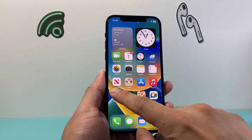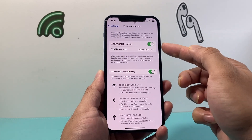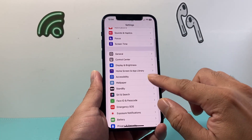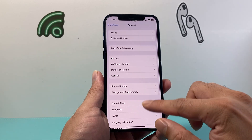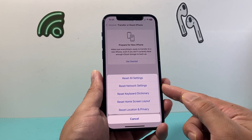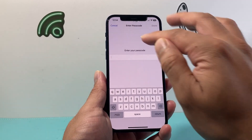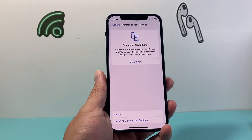Once you're back on your phone, simply go into your settings. If it's still not working, verify that personal hotspot is turned on. Then go into general, scroll all the way down to transfer or reset iPhone, click on reset, and you want to do a network reset, which will basically reset settings like your phone's Wi-Fi.